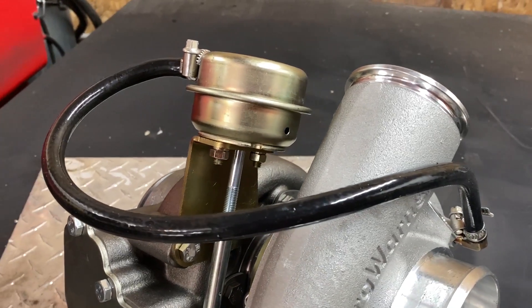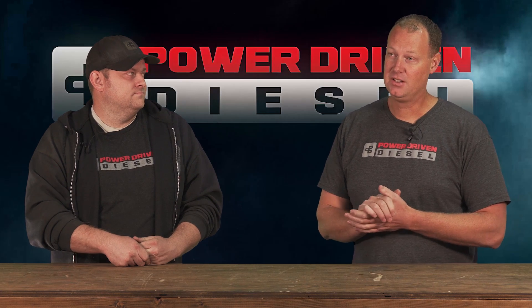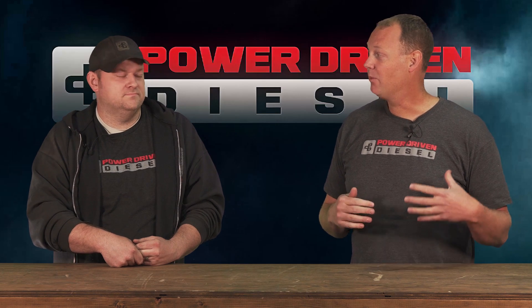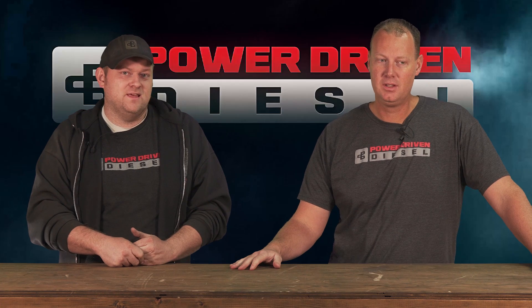We're doing the 6688 with a large turbine wheel to make the power we want. This turbo is internally gated. The advantages: an external wastegate is an awesome setup for a race vehicle, but there's a lot more maintenance and more potential for exhaust leaks. On a race vehicle it's a great idea, but on a street vehicle I like an internal gate because they're maintenance-free — no extra potential leaks since it goes right into the exhaust of the turbo. For a street truck at this power level, an external gate isn't warranted.